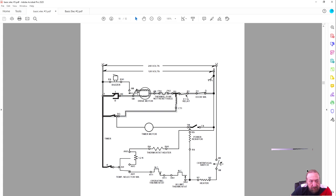There's something important about resistance in circuits — thermistors are sensors connected directly to a control board. In the dryer diagram, the timer motor can go through a switch or through a power resistor. If you go through the resistor path, you're putting two or three resistors in series including the heating element. But if that switch is closed, electricity bypasses the resistors via the path of least resistance. I'll go over specific instances explaining why current takes one path over another.